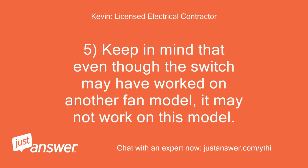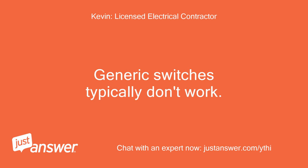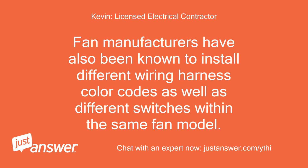5. Keep in mind that even though the switch may have worked on another fan model, it may not work on this model. As I mentioned before, an exact replacement switch must be purchased, if it can be located. Generic switches typically don't work. Even though a switch may look identical on the exterior, the interior of the switch can have different switching patterns. Fan manufacturers have also been known to install different wiring harness color codes as well as different switches within the same fan model.